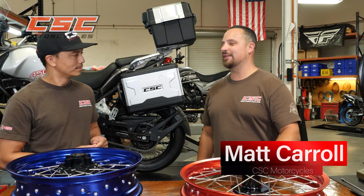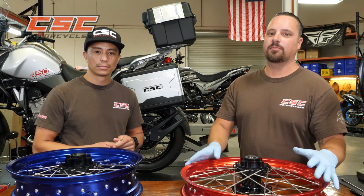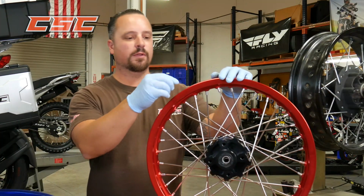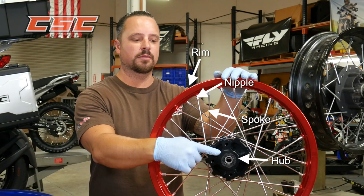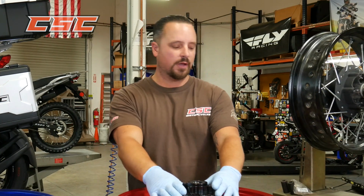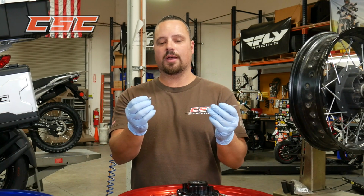Thanks, Joey. I'm excited to be here to discuss wheels and particularly wheel maintenance for your CSC motorcycle wheels. Probably the best place to start is just to look at the main components of the wheel. And what we're looking at is the rim, the nipple, the spoke, and the hub of the wheel. These are the components that make up the wheel, and essentially these wires are laced through the hub. So you could look at spokes and nipples as being fasteners. You have a bolt and you have a nut.